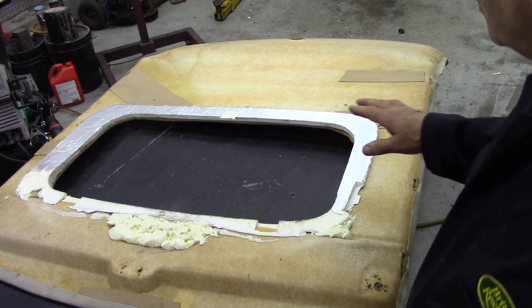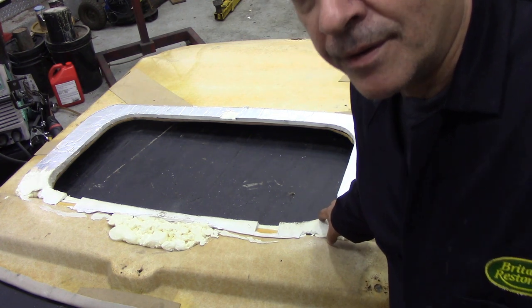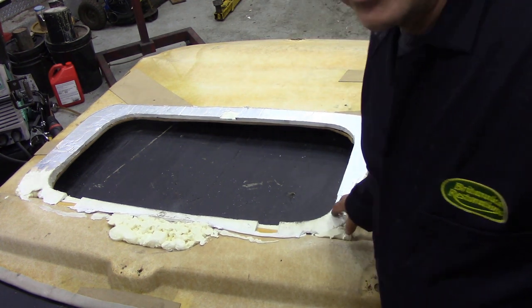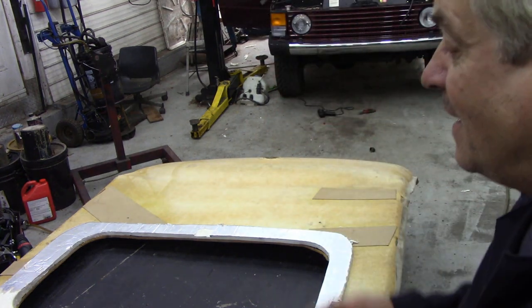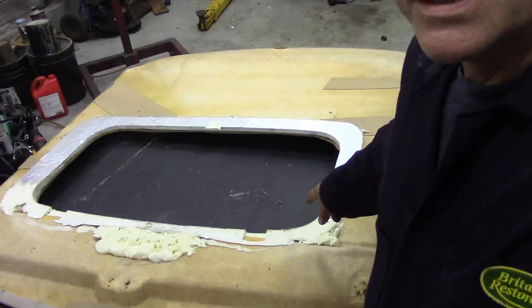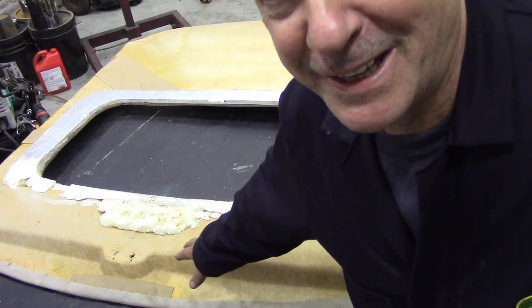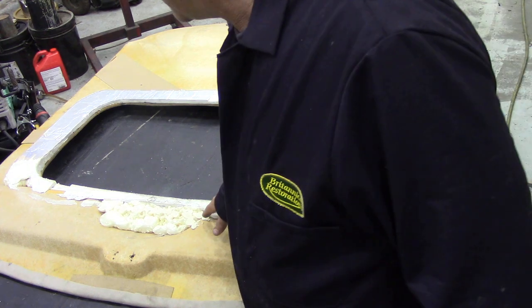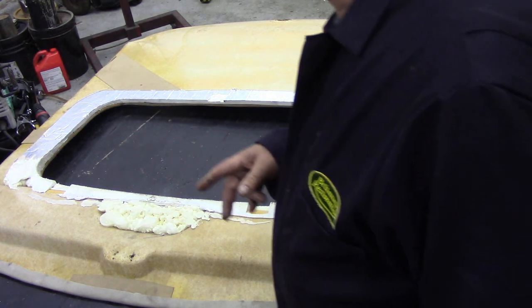What we did was get some half-inch styrofoam or polystyrene insulation and bonded it to the roof with Gorilla Glue construction adhesive. Styrofoam polystyrene doesn't like a lot of glue, so Gorilla Glue was the only thing we could use — and it worked really well. For three quarters of it, it came out quite nice. The front though was an absolute nightmare. You can see we've been slowly filling it with spray foam to find a level and then chopping it down.